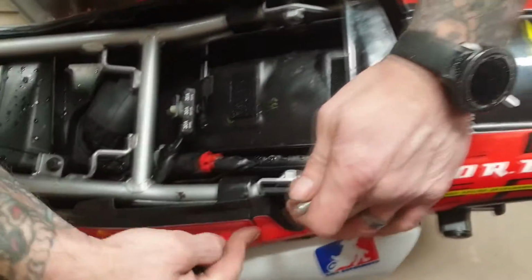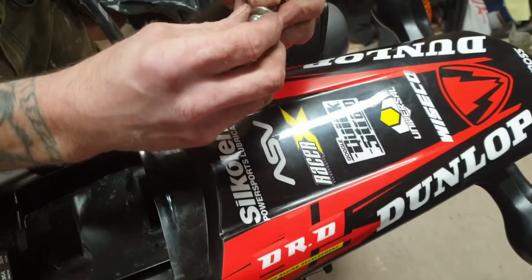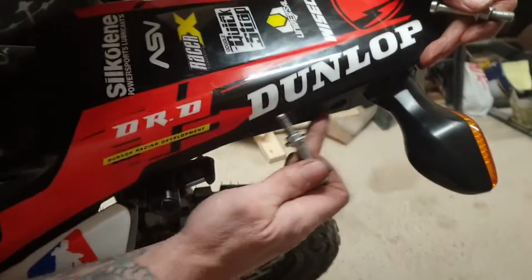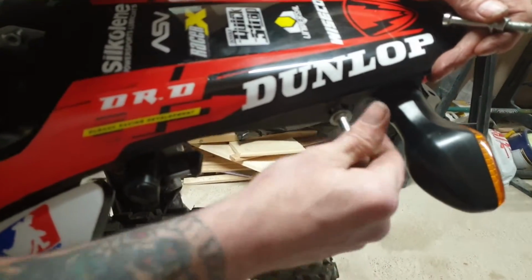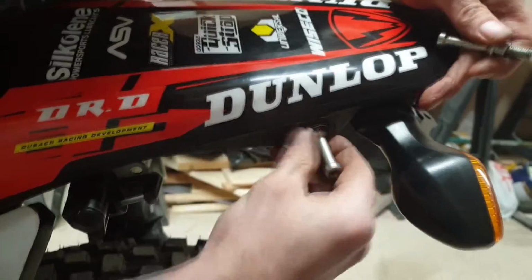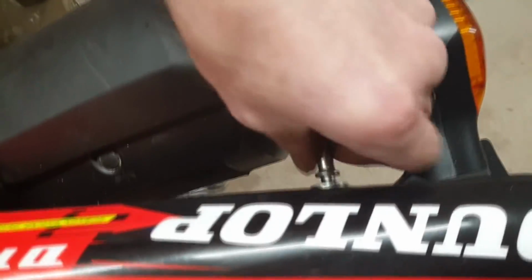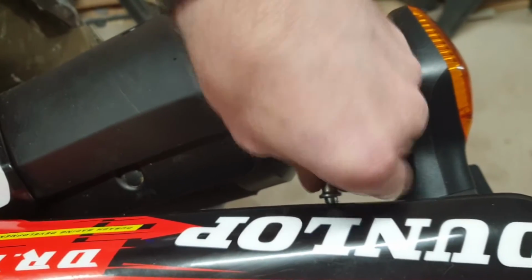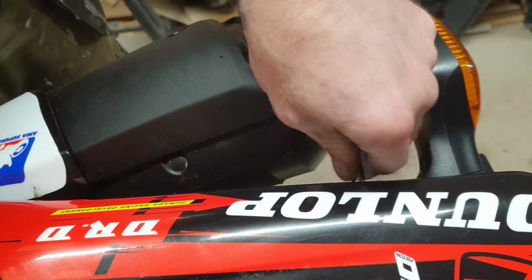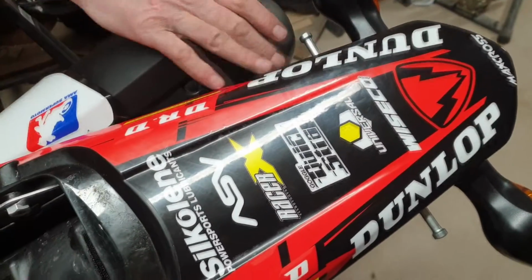There's some little rubber grommets behind there. They just push in. Now we're going to use the rear luggage mounts. We're going to put them in first and make sure everything's lined up. Just put them in loose. Make sure your actual top hat spacer is locating into the actual plastics. So just offer them up loosely and then tighten them up and make sure it's not nipping the plastics up. Okay, they're nicely tightened up.